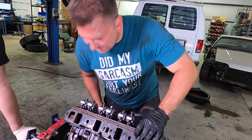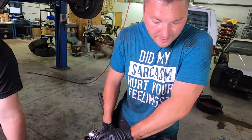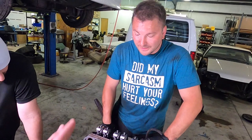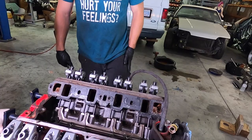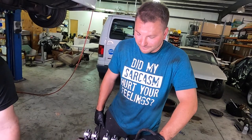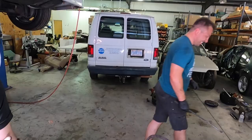We've got Eric from Prestige Motorsports here by the way, so check their channel out if you haven't before. It's got main girdles in it — I mean, it was a pretty healthy motor. It's 400 horsepower all motor on a 306, basically, but at 8.4 to 1 compression. It was built for a turbo. That's a lot of power for low compression. Yeah, so we're figuring out why our plugs have water on them and why other things have water on them. The plugs came out and they have water on them too, and we saw it in the cylinders as well. We're going to take a look and we got some broken porcelain — probably went into hydrolock. Probably got a blown head gasket based on the water. Hopefully just head gaskets.